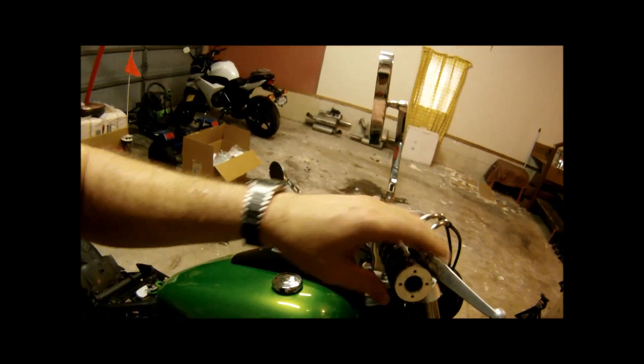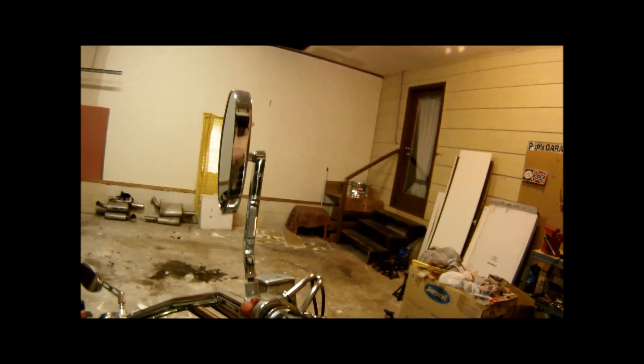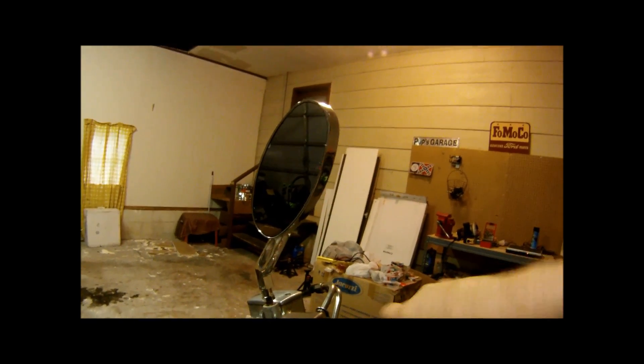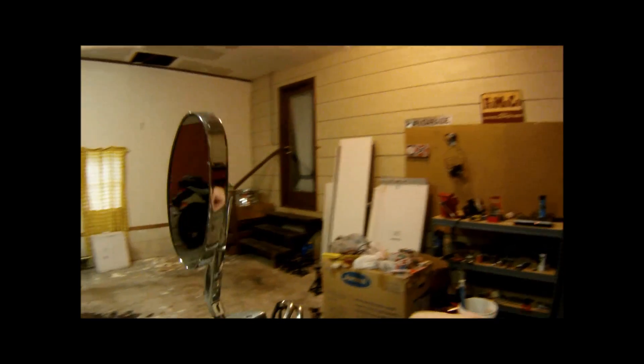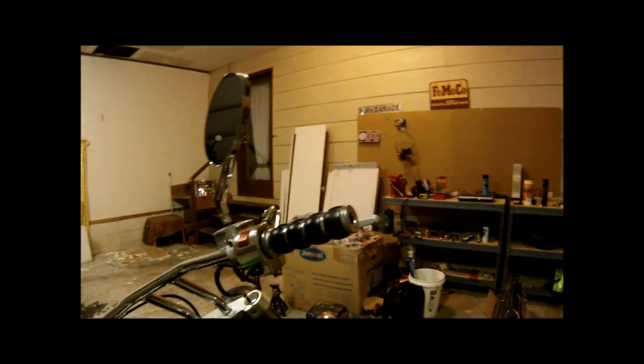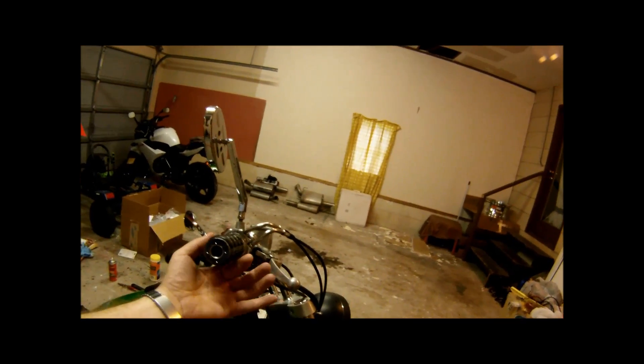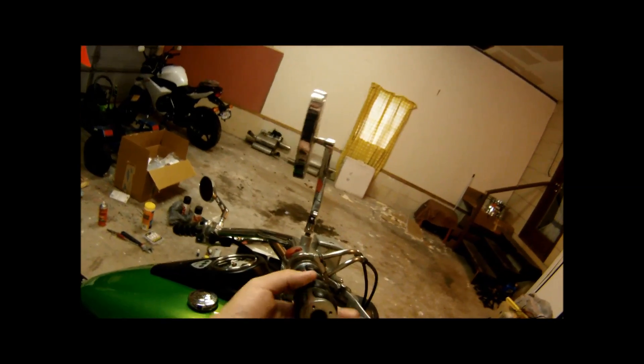It's weird - I took these bar ends off and on this end with the plastic on the throttle, it used to snap right back, but now it doesn't want to snap back right away. I don't know what the deal is with that - it's not glue or anything. I guess this new grip squishes the plastic enough that it makes it not want to return all the way. I may have to look at getting a stronger throttle return spring, and it may need some lube in there to help. It's not wanting to return by itself at all, so we'll get that taken care of. I'm gonna let this cure up, leave these ends off so it can off-gas, and then proceed with the wiring. Stay tuned.